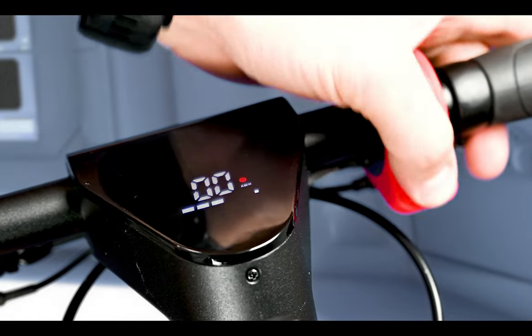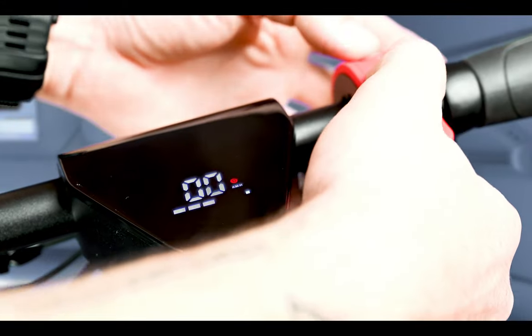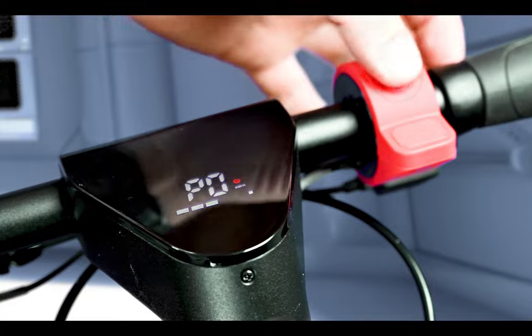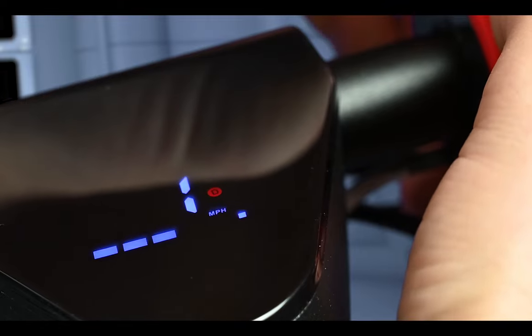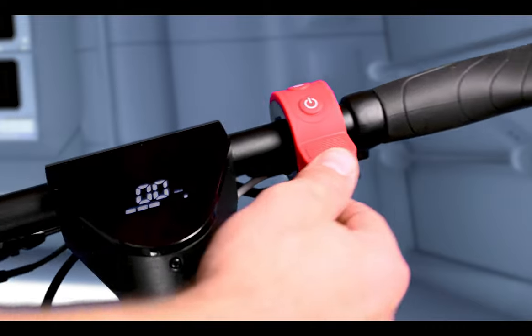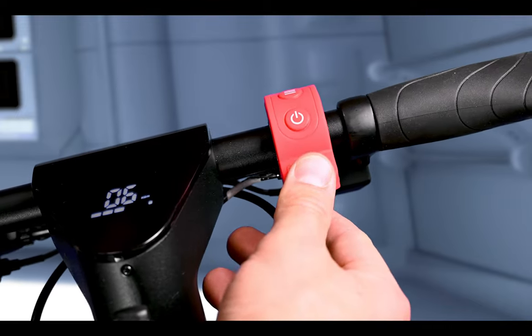Stock, it is not in zero-start mode, but if you press the ON and MENU buttons together and hold them, you can enter the parameter menu. P0 is kmph versus miles per hour, P1 is cruise control on or off, and P2 is zero-start mode. The seller says the scooter goes up to 40 kmph — we will test that in the ride review video.